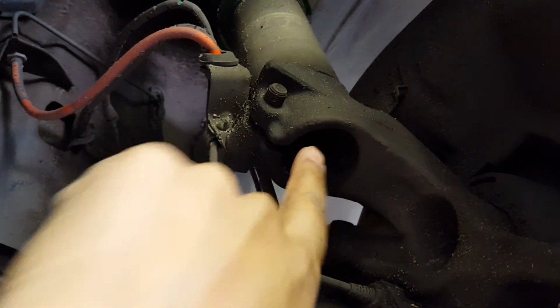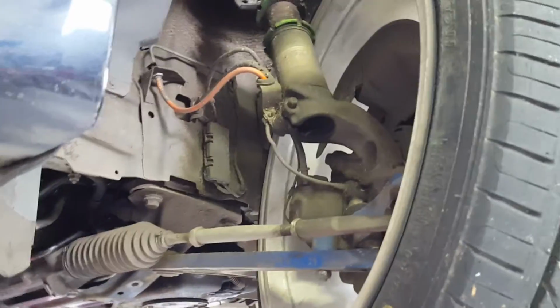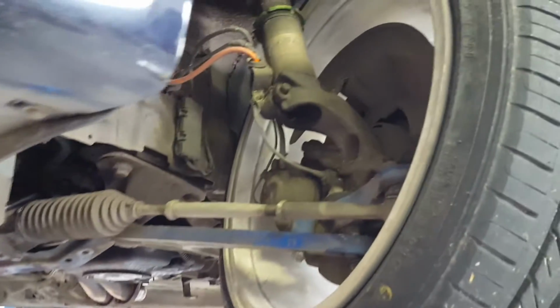It sits up there in that hole, you know? I don't even think you can see it, but you have to put an Allen key, size 4 or whatever it is, up into this hole, find the middle, and then that little screw, and then you can adjust the sensitivity, how hard and how soft the suspension is. That's also sad. But okay, the HSD suspension is about €1,000.